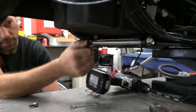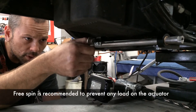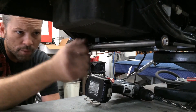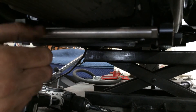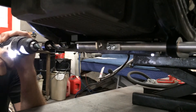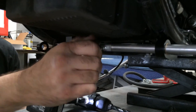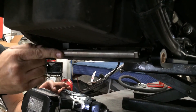We're free spinning in here. I actually wouldn't mind if this was just a little bit better — I really try to make it so there's no load on the actuator and it's able to free spin quite nicely. I'm going to pull it back into this bushing and the shaft is wanting to hang at a downward angle. This would be pretty perfect. I'm going to push this back through and work this bushing one more time, going in the direction it wants to go. If it's hanging like this, we need to make room like this. We're going to open up that bushing. Our fit is getting much, much better.